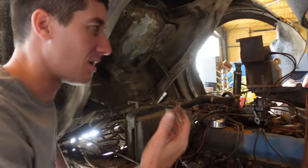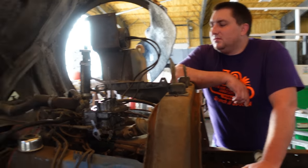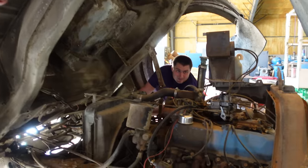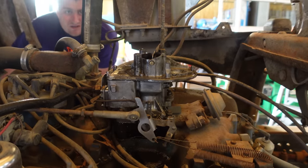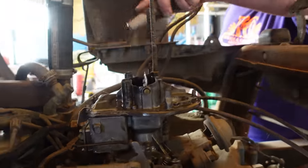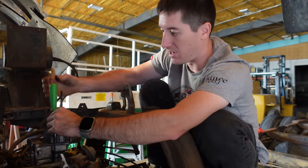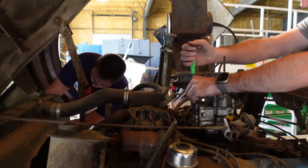I have a new ignition switch, but honestly, the wiring is so messed up. You put a new needle and seat in? All new. I guess we gotta pull the top back off and see what's going on with that. Maybe we just need to wiggle the... Oh. Okay, no leak. No leak. Leak. There. Waterfall. We need a hammer. Well, it turns out there's a little retainer clip on that float, and that wasn't clipped in to its socket. As soon as we clip that thing in there, go for it. No more leaks.